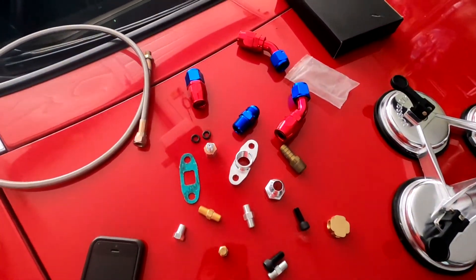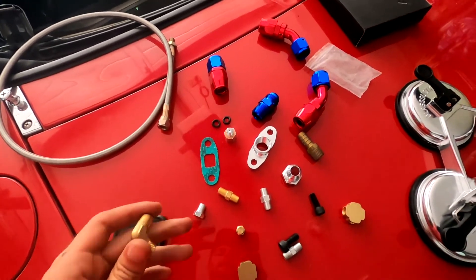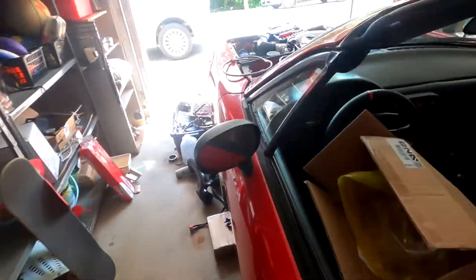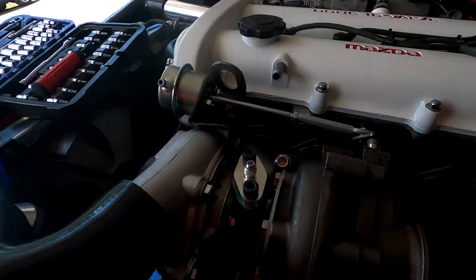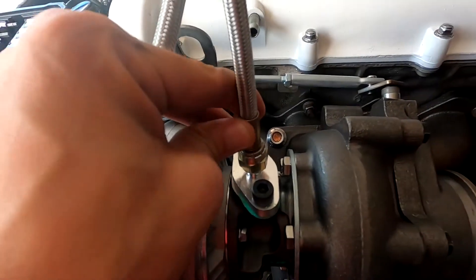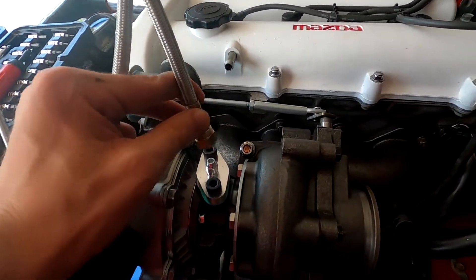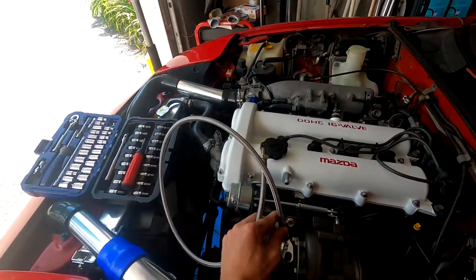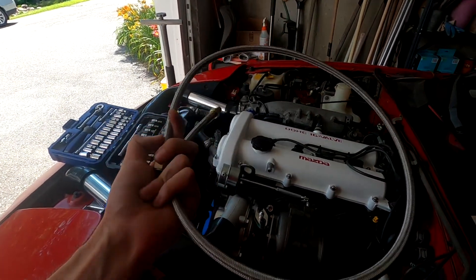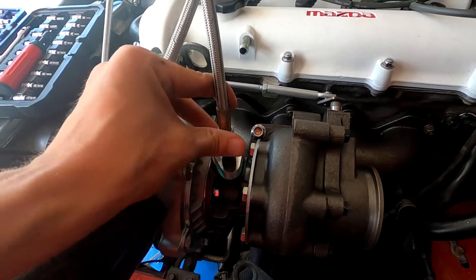Now that we've got that adapter on, I'm starting to really notice the limitations of these eBay oil feed line kits. They're not complete, and I expected to need to buy more stuff. But this is the only 90-degree fitting that came in the kit. You need your oil feed straight up on your turbo so you don't damage anything, and that means this oil line is going to stick up super high. For now, since I don't have the right fitting, I'm just going to get everything installed as-is because I'm running this thing with no hood to start. I will have another video down the road adjusting this oil line so the hood will close. This feeds right on here — this is the AN fitting, so you just need to tighten it down and it'll seal on itself nicely.